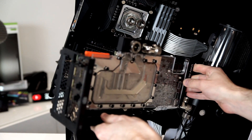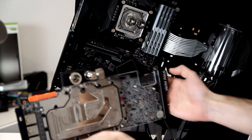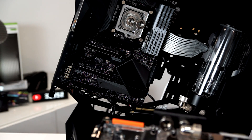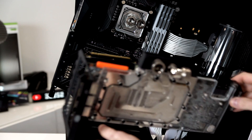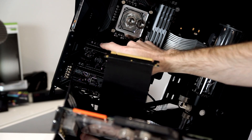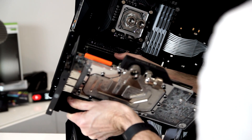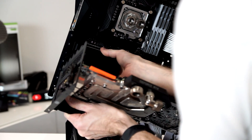As I mentioned in the previous video, the graphics card is a very tight fit inside the case. The Aorus logo sits right up against these mounting brackets — not quite touching, but there's probably less than a millimeter of clearance. That's how I like to do things. The graphics card itself is sitting inside a Cooler Master vertical GPU bracket, the same one I used in the previous build. We've got a riser cable which plugs into our PCIe slot, and then the mounting bracket goes into place. We start by plugging in the riser cable into the slot and making sure it's clicked in.